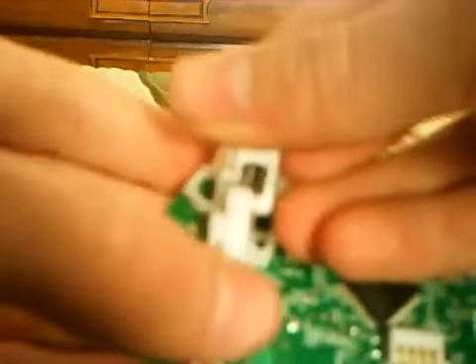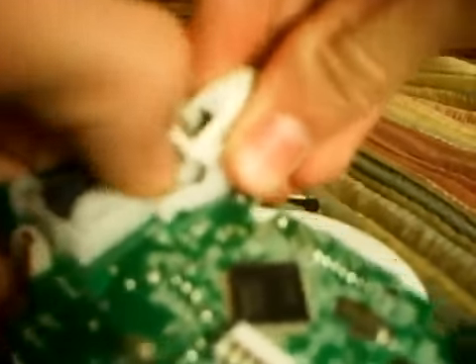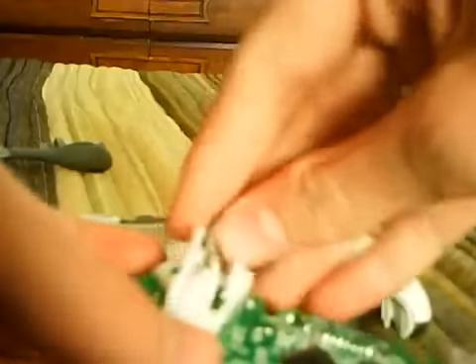There you go. Also, just pluck these off — you'd want to take those off too. For the triggers, all you gotta do is push this to the left and down. Then push this forward and you might want to catch the spring. Then just take it off just like that.